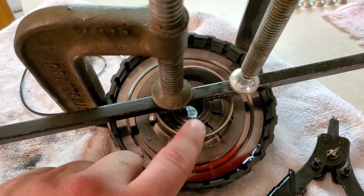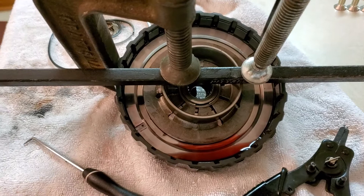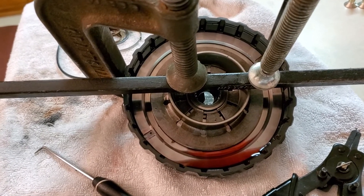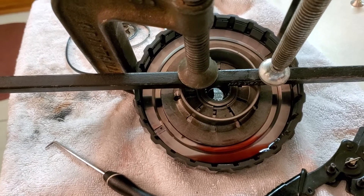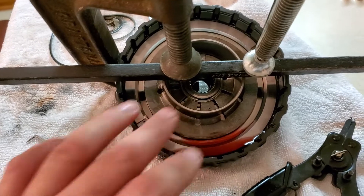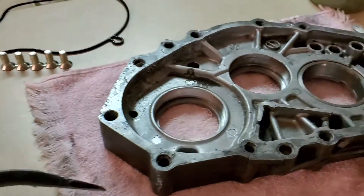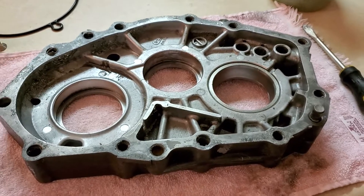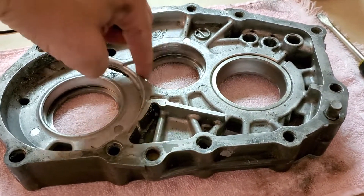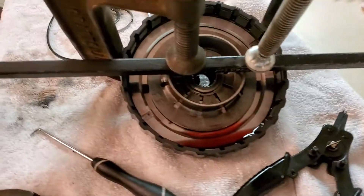What I did — I've got the bearing race like he did in the video. If you don't have a bearing race that'll fit, I can't do nothing for you there, so you'll have to figure out something — get an oversized socket or cut some notches out so you can get to it. I'm using the bearing race, and honestly that's probably the easiest thing to use. Some spare parts from my manual transmission since I blew it up — this one here is the race I've got. If you use one of the bigger ones it may be too far out to the edge.